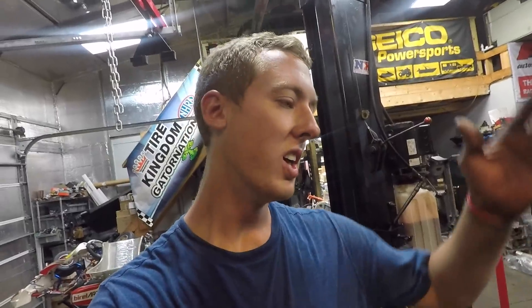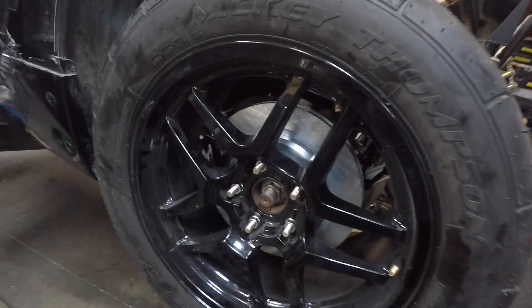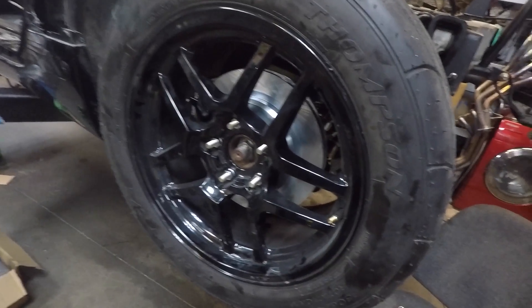It's been about two hours since my last update. It's literally five o'clock in the morning and I have just figured out how these brakes are gonna work. I had to shim them about six different times to find the right fit so they're just centered on the rotor. Made my own shims, was grinding them down and stuff. Here's a little sneak preview — see how it's moving nice and freely in there. Those brakes look beautiful in there. Time to do the other side. Man, that was a freaking piece of work. I've never done brakes before and that was a pain.